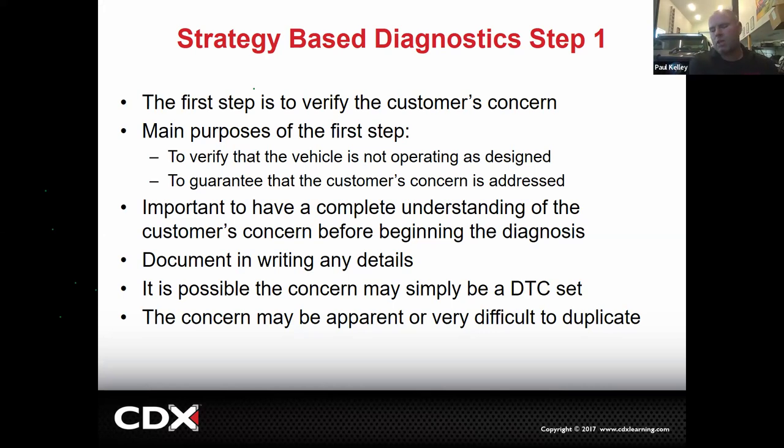I'm willing to bet you there's actually nothing wrong with the car. I'm willing to bet you the real issue is he just needs to not drive that aggressively. But the thing is, he took it in, they verified the pulsation, they cut the rotors, and then it pulsated again, they put new rotors on, and now he's kind of built a case on this dealer already. He's saying, well, it's a lemon.